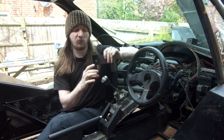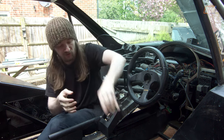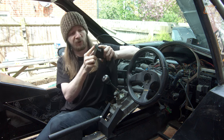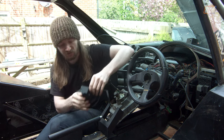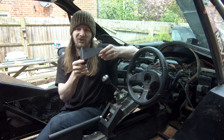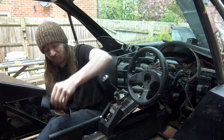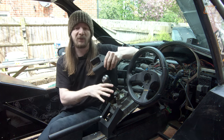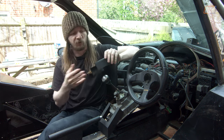This is the first front piece we made - it mostly worked apart from a schoolboy error: we didn't knock out the front inside corner where there's a radius on the shifter, so it was an interference fit and didn't work. Version two we tried to do too much at once - we knocked the corner out and put a radius in, but also tried to put a big undercut on the front edge where it'd go underneath the foam, and the geometry didn't work on that. We then did experiments with rounding the shoulders over for a nicer profile, using shorter test pieces to get print time down to bash through them quicker.